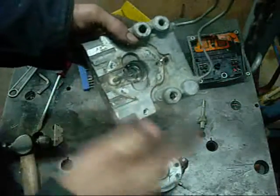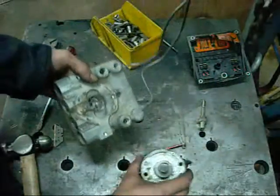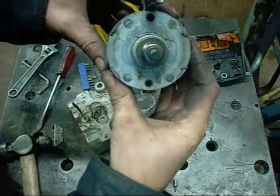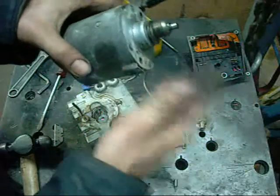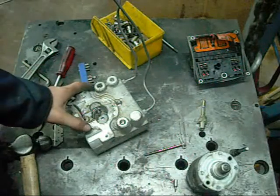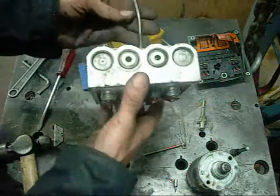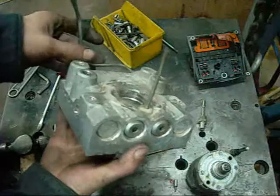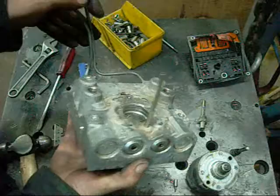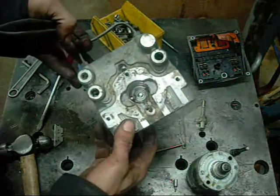Oh I see — that oscillates from one side to the other, varying between rear brake and front brake. That's a cam, not a bearing. The end of that shaft is ground eccentric, so all that does is oscillate — it moves the piston back and forth. That's the pulsing that you feel when you hit the brakes and your ABS kicks in, like on a wet surface. That's when ABS really helps — if you're hydroplaning, it breaks that hydroplane and lets the tyres rotate a bit and purge the water. Unless your tyres are worn below minimum level, in which case ABS won't save you.